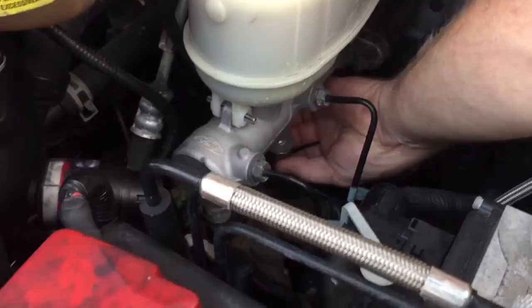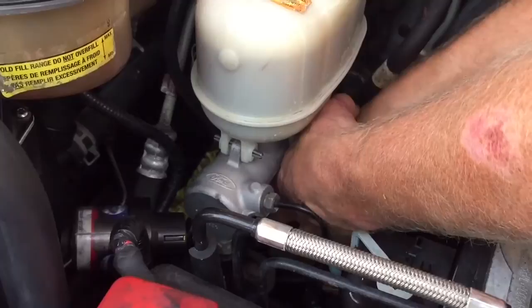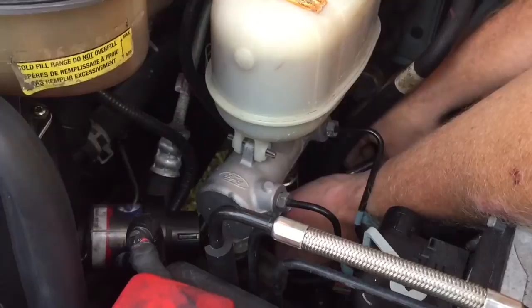I can take it out and I'm going to try to do this as quickly as possible so I don't drip any brake fluid. It won't come rushing out but it will drip, so I'm going to do it as quick as possible. I tightened the new one up as tight as I could by hand so I make sure I don't cross-thread it in the master cylinder. Then I put my 15/16ths back on the transducer and tighten it the rest of the way with my ratchet.